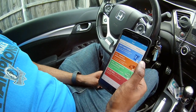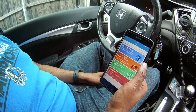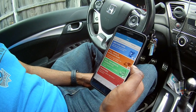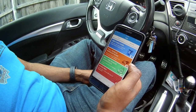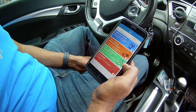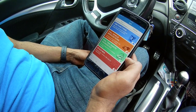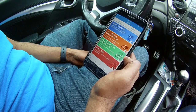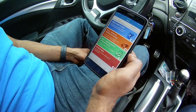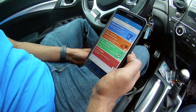As you can see there are four different modules. OBD functions is to basically check for check engine lights stored in the system or current check engine lights. Full vehicle scan scans all different systems such as transmission, ABS, airbag lights, four-wheel drive systems, heads-up display, or any other applicable systems. Real-time remote diagnostics lets someone remote into your phone to look at data and help you diagnose a problem. Black Box records readings like temperature and O2 sensor data while you drive with the scanner connected, which can also help diagnose problems.